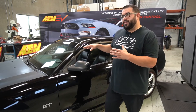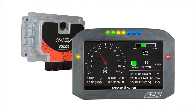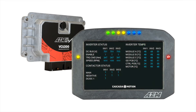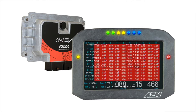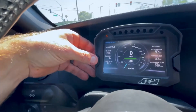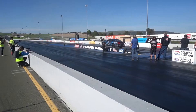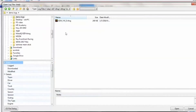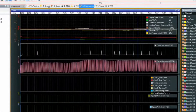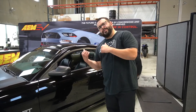With the VCU, when you pair it with our CD dash, there are literally hundreds of channels transmitted out from the VCU — everything from motor performance aspects, all the information from the drive unit, the inverter, the current statuses of all the other systems on the car, and battery management. It's spitting out tons and tons of data. The CD dash also offers data logging, so if you're racing or auto crossing, you can visualize and monitor live data, capture it, log it, and review it for post-processing, tuning adjustments, and driving adjustments.